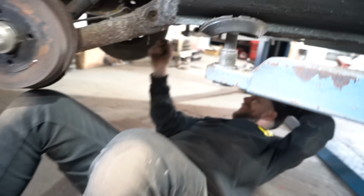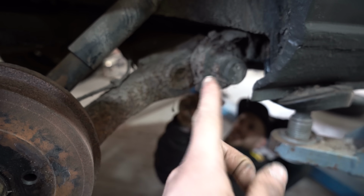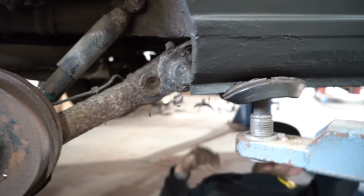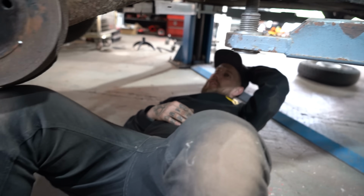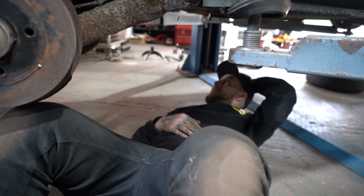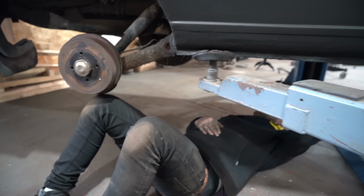Yeah, French cars. So what are you thinking? Take the torsion bar out of here. What does it do? Come out this end? Yeah, if you just knock it so it's off the splines, in theory, you can turn that and knock it back in. That makes sense. I thought so. Whether I'm right or not, I don't know, but it made sense to me. Well, let's give it a go, see what happens. Yeah, that's what I'm thinking.